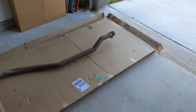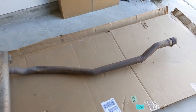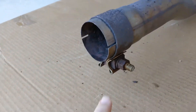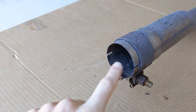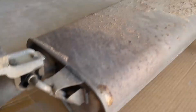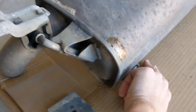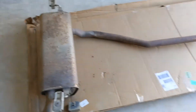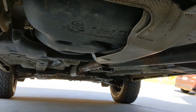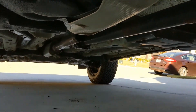So we got it out of there. This center section just slides out — this bolt was a 15 and then that just slides out. These back ones are a 13 millimeter to get both of those out, one on each side. It pretty much just falls out and you pull it out from the front. Now there's just a big hole where the muffler was, and you just have your pipe dangling in the center section.